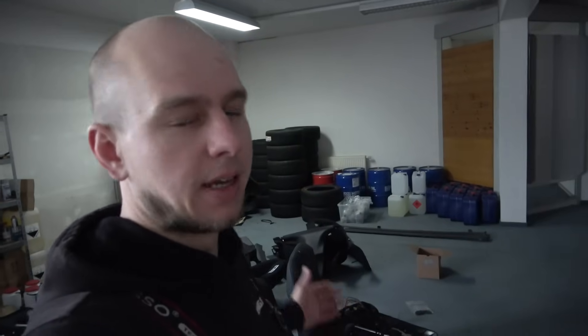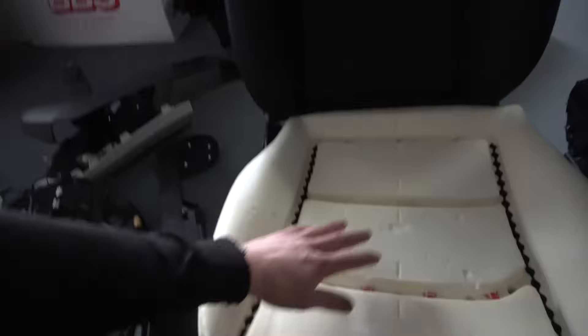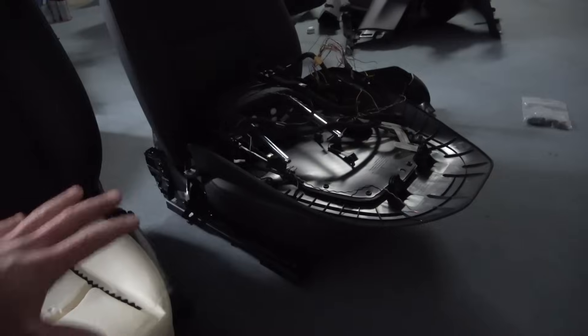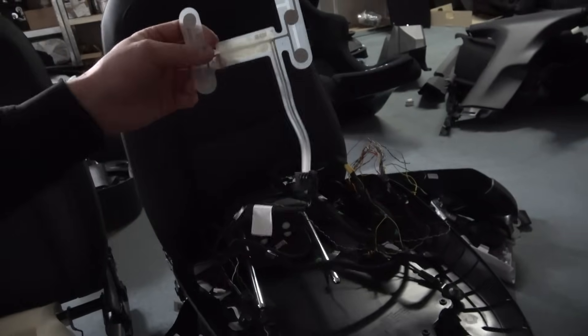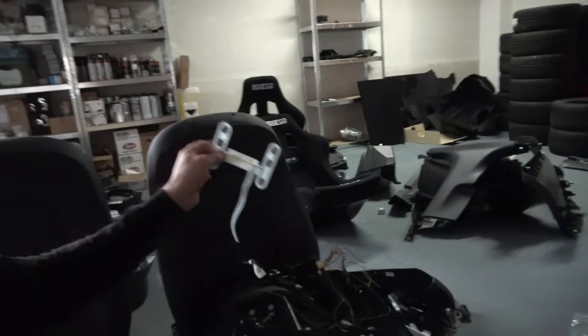I'll show you what I had to do to test all the seat sensors and the airbag. Behind me you can see both front seats of the Tesla — I had to completely disassemble them, removing the bottom of the seat where the seat weight sensors sit. The driver's seat must have this weight sensor because it's partly like a start button for the car — when the driver is in the seat it enables the car to drive, and without it the car cannot go to sleep. I've been working on the electrical systems to make the car think the driver is present both when driving and when parked.